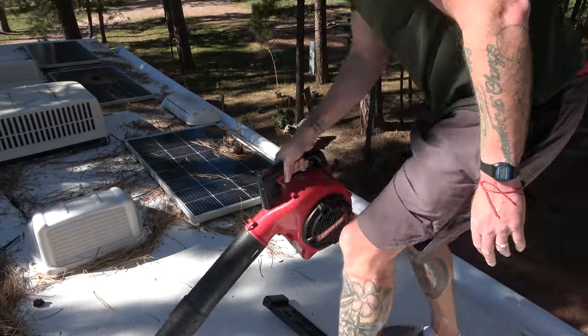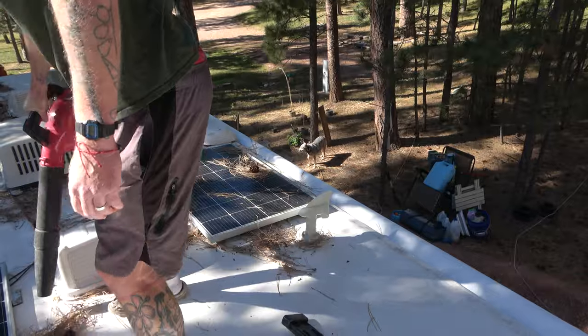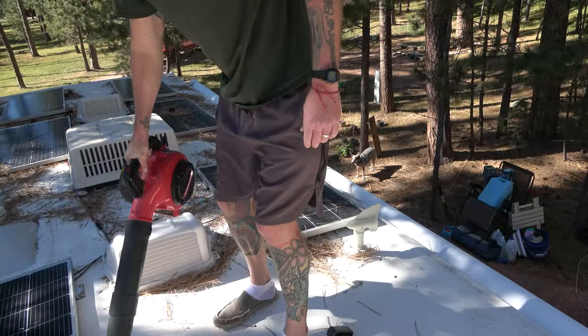At that point, I'm going to do a visual inspection just to make sure that there are no obvious or glaring places. I'm not going to get down too close, but we're going to wash the roof before we patch it up. That may not make sense, except I'm telling you the only places that need a patch is over the Turnabond, and the Turnabond is watertight. So I'm not worried about rinsing down the roof before I go back and dry it out and spray that on.